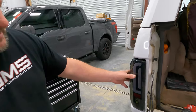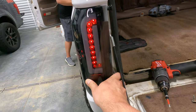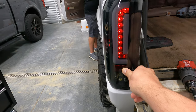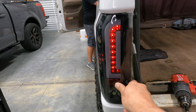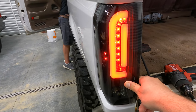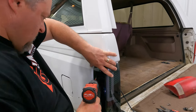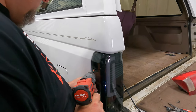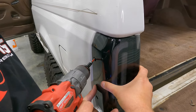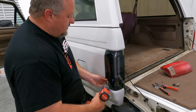It fits like a glove. We'll put our screws back in, but let's test it before we put any screws in. Fire it up — oh yeah, lights are on! Hit the brakes — oh yeah. And then reverse light, left-hand turn signal — blinkin'. We'll have to start it up to do the reverse lights. That is lit. I would highly recommend that you use a screwdriver, especially there at the end — don't want to over-tighten and break your new light.